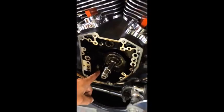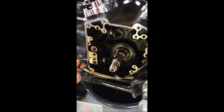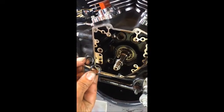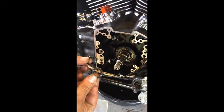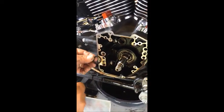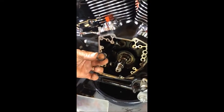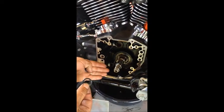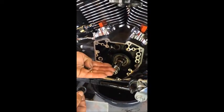This is a common, common mistake. Pulled this O-ring out — it looks fine, it actually looks like it's made to look like that. And this is a good one. You can see how much more square and dense this is. So when the oil pump goes on there and you reuse an oil pump O-ring that's hard like this — I can't even squeeze it — whereas I can squeeze that good one.